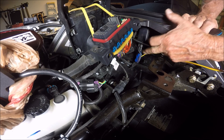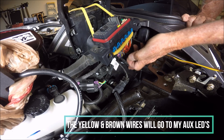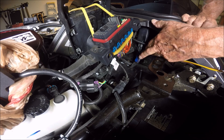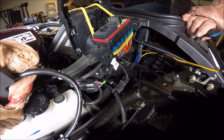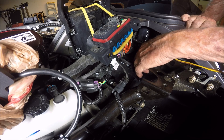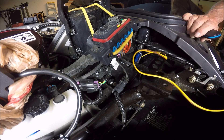So this is a good place to do your wiring for the auxiliary turn signals — just either one of these: solid blue for the left, and for the right I grab one of those and I am set to go. I want to show you pins 11 and 8 — that is your left and right front blinkers. I peeled back the insulation there enough that I could get access to the two wires: the solid dark blue and the dark blue with a pink or red tracer.